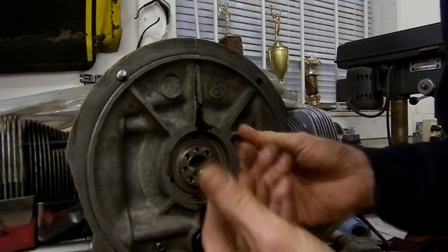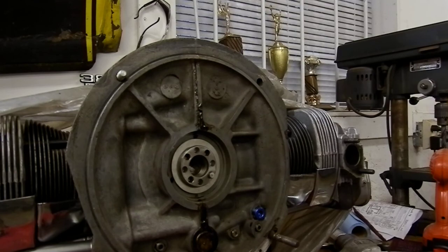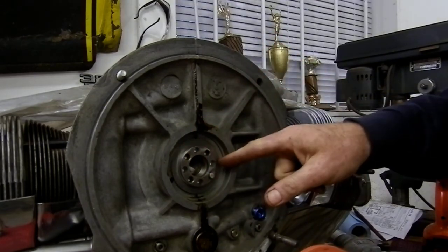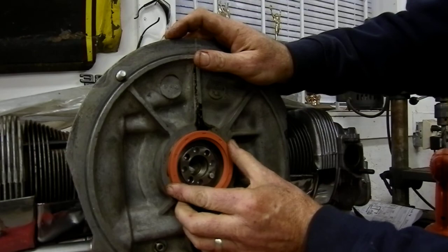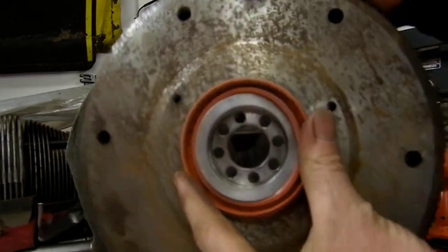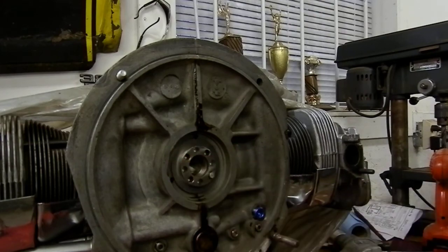I'm going to put these shims in dry — there's a little residual oil on them. Once the end float is established and the right clearance confirmed, I would lube everything up with white lube or engine assembly lube, put all the dowels in, and then before installing the flywheel I'd install the rear main seal that sits right on the end of the crankshaft. Not a bad idea to check the fit too, just to make sure it seals tight and will stop oil from coming out.